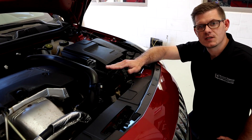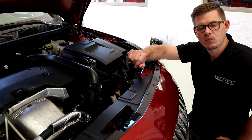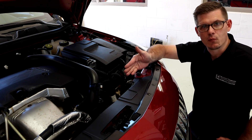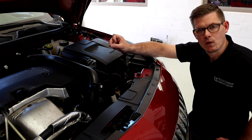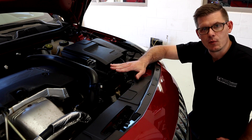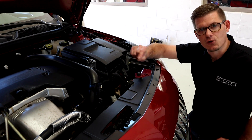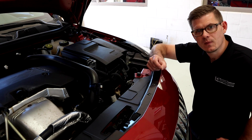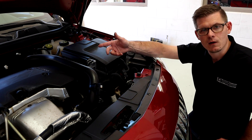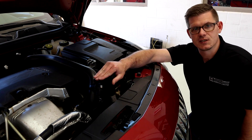Our sensor is zero to one volts but we don't use that entire range for signals to the PCM necessarily. We leave small windows at the bottom and top — from zero up to 0.05 or 0.1 volts, and from 0.9 up to one volt — to help with diagnostics. It's similar to a TPS throttle position sensor on a zero to five volt scale, where zero is diagnostic for an open circuit and five is diagnostic for a short. We see a similar concept in the oxygen sensor.